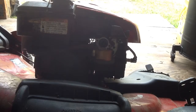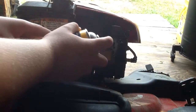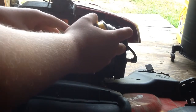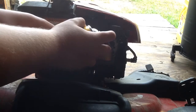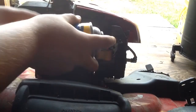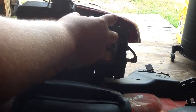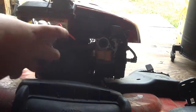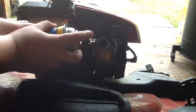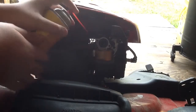So now, instead of taking the carburetor off, you can just get a carb cleaner and spray it in every one of these jets. There's one here. Just fill it — get a lot in there, make sure it's all clean. There's actually one right in here too, just try and get some in there. Then there's one right in there, and one right here for the primer — spray right in there.